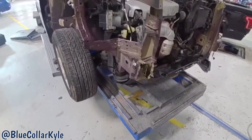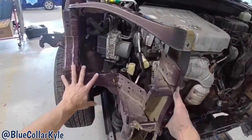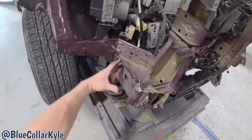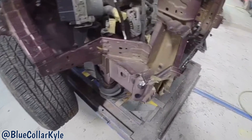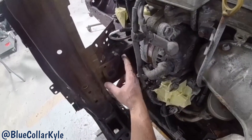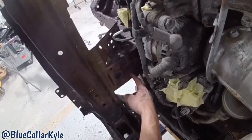I'm going to start cutting this one apart — cut this apron out and get it out of my way. Then I'll get the procedures for the sectioning of the frame rail and make my measurements. I can't remember exactly — it's right in here where they want to cut. I can't remember if it's right on this laser seam or not.